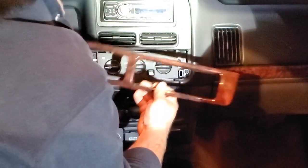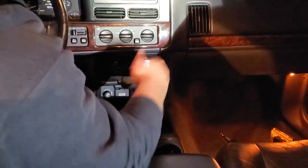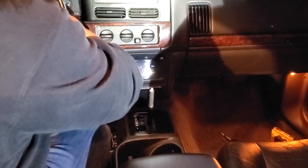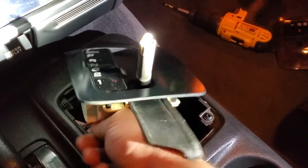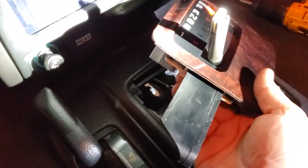Just gonna take off this trim - easy peasy. Pop on this new trim. There we go. Now we're gonna do the shifter bezel trim. You're gonna want to turn on your vehicle, put it in neutral or one of the rear drives. Let's go all the way, and we're just gonna rip the shifter straight up - there we go, that comes off. Now we can turn off that annoying sound. We're just gonna pop this up. On the bottom is a little light bulb we're gonna unplug - that comes out. And this just slides up. Bye-bye old bezel - I grab the new one. New wood grain shifter bezel, nicely restored. Go slide your shifter through that hole and I gotta plug in this light bulb right down there.